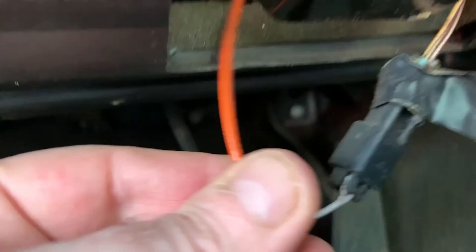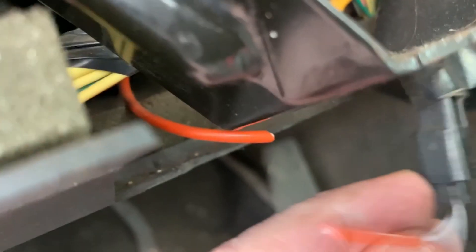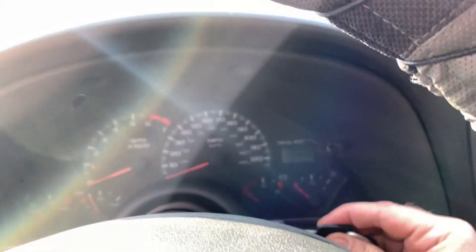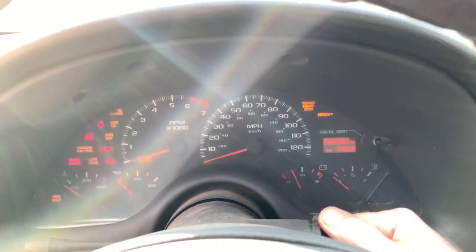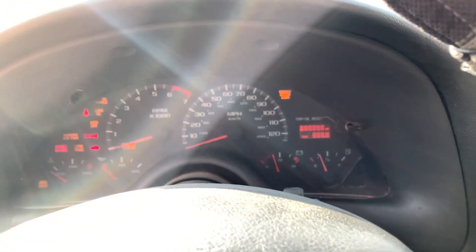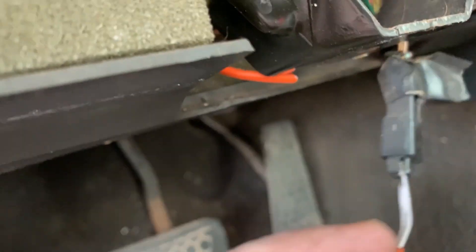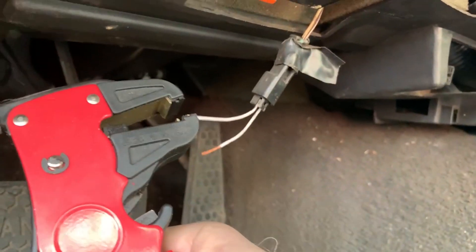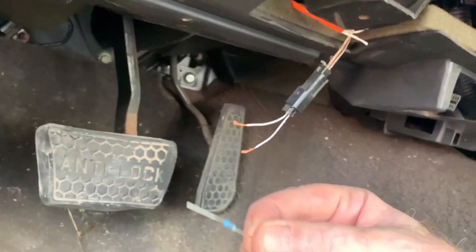Let's look around a little back here — and there's the orange and white culprit we're looking for. That's got to be the one. I cut the wire, and one way to make sure it's the right one is to try to start the car. If this starts, we have a problem, because that means we cut the wrong one. So far so good. Now we just got to strip these wires and attach that resistor. Since resistors are directionless, it doesn't really matter which way we put this. And there you go — just that simple.